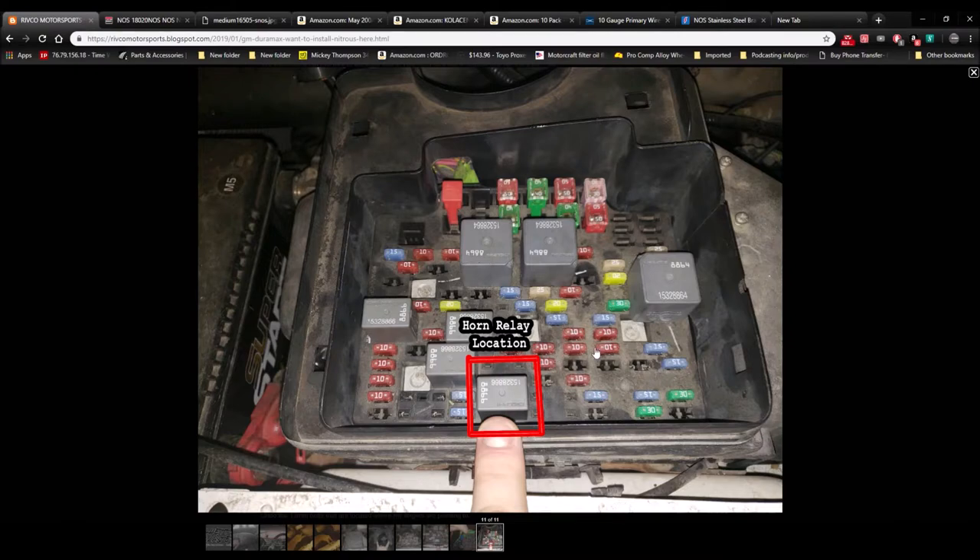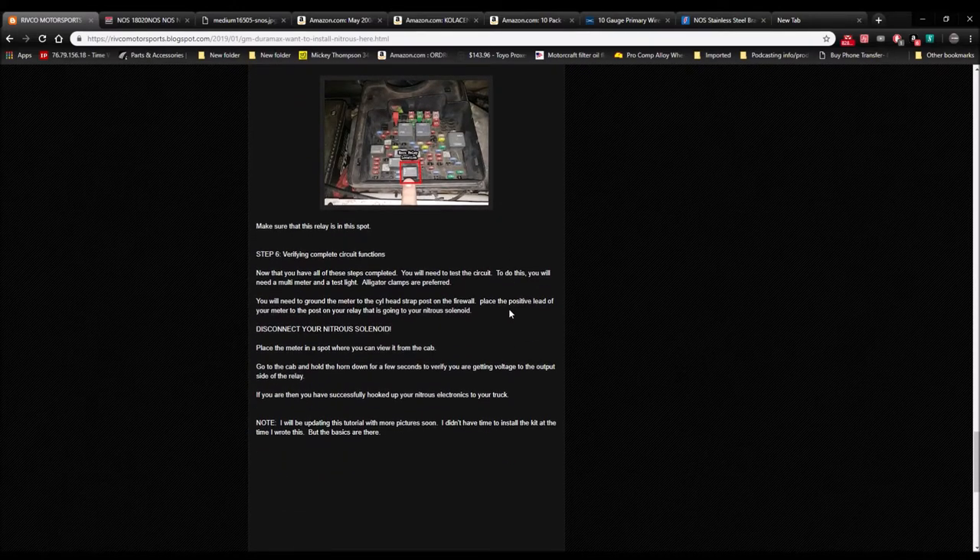Now the most important part: verify the circuit. One thing I forgot to mention — you need to verify your horn circuit functions. If your horns work, you're good to go. If they don't, diagnose the issue first. Check whether the horns themselves are the problem or the horn circuit, or just a blown fuse. If you keep blowing fuses, find your short before doing anything. Once you've confirmed the horns function as they are — go out and honk the horn, or lock the truck and hear it beep — you're good to go.